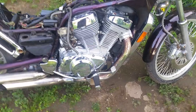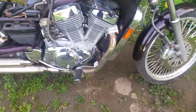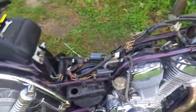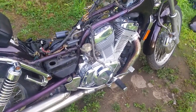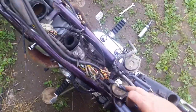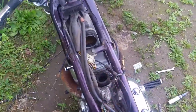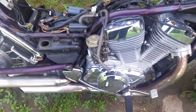It's two different heads but they don't have the intake on the same side — kind of a poor design. Anyway, I'm pulling off the carburetor and going to strip it down, put it in the ultrasonic cleaner, and see if I can get any crap out of it. This carburetor on this side ran perfectly fine — there were no issues with it. So I think I'm going to leave that carburetor for now. I just have to make sure that you synchronize them. I might pull it on the next video.